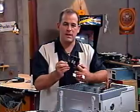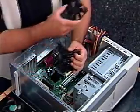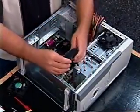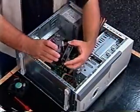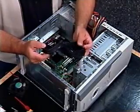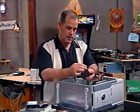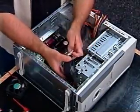These are called muffin fans or biscuit fans. We want to pull air in through the bottom of the front of the machine and blow it out at the top of the back. You want to make sure your fans are aligned the right way. This case is pretty nifty — it has a little plastic cage for the front fan, creating a sandwich on the front of the machine. You put the label side in or out depending on the direction of airflow. Since we're drawing air in, we lay the fan down label side in and snap it in place.